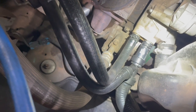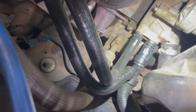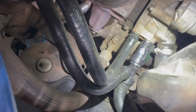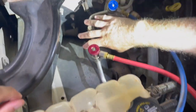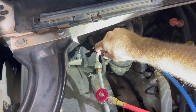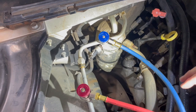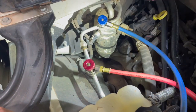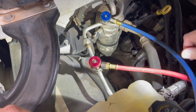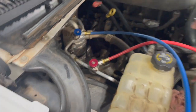So it's off right now. Compressor's on, compressor's off again. There is a little bit of a touch test you can do — it is making some cold — but it looks like a classic case of low charge. We pulled off one of the service port caps and it has a little bit of pressure behind it, like one of the service ports is leaking.